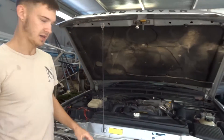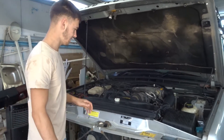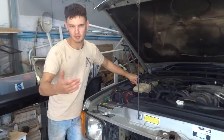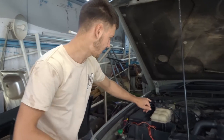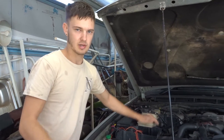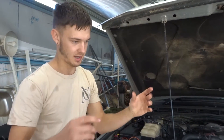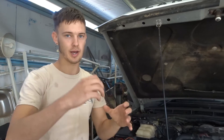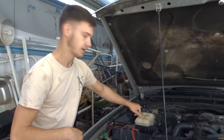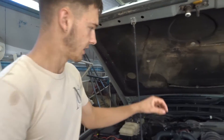You can see a lot of oil leaks around the head gaskets, so either way it's got to be changed. As you can see it runs brilliantly — there's no piston knocking at all. You can also see a lot of vapors coming out of your coolant reservoir — that can indicate the head gasket is basically shot. The gasket can push pressure and exhaust fumes into your coolant; if you dip your finger in that water and smell it you can detect the fumes.